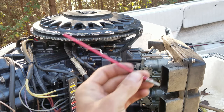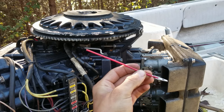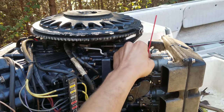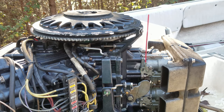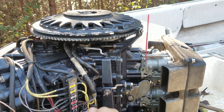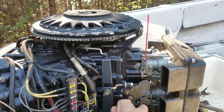So you take the little tool we just made — and the technical term for this in the service manual is actually called a throttle shaft amplifier, I know, right? — and you clip it on here just like that. What that's gonna do is translate this tiny, tiny movement into a big movement. When you barely move this thing, you can see it moving. You can't perceive the throttle plates opening by eye with that tiny movement, but since it's a long straw, now you can see the tiniest little movement translates into a visible movement of that straw.